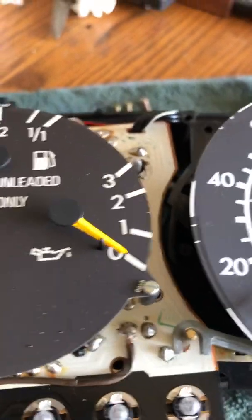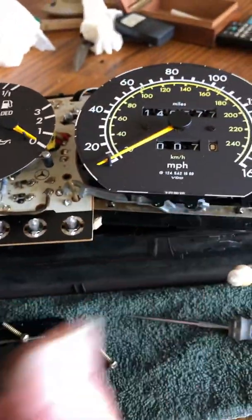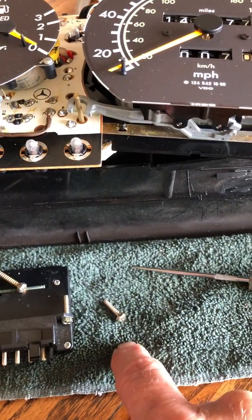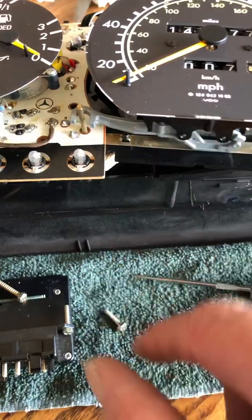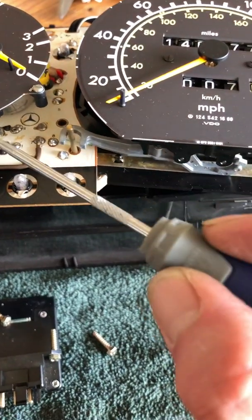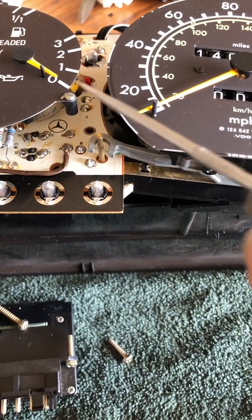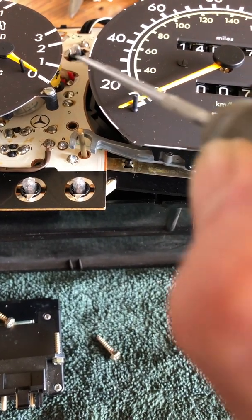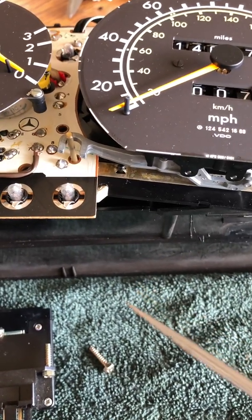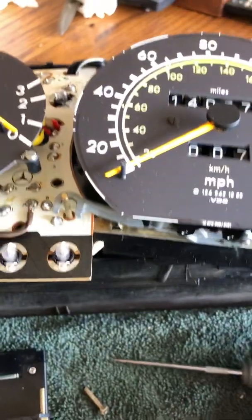I'm trying to figure out this one. I'm going to keep working on it and probably go and test the wire from the sender to the instrument cluster — just the negative wire. The way this works, from what I understand, is that the negative lead starts at the sender by the oil filter, travels through, and goes to the gauge here. The gauge has a positive on it, and that completes the circuit. The sender itself has some kind of pressure device built into it that makes the needle go up and down. But it's a brand new sender.